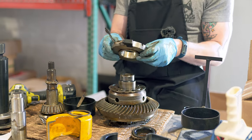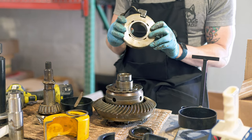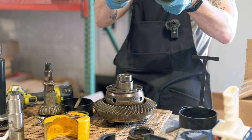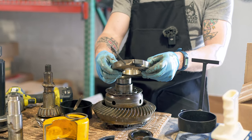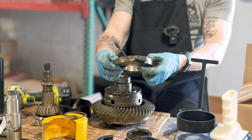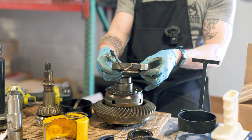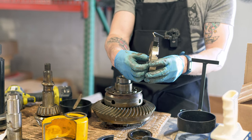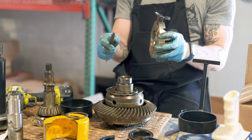If you're this far into your factory locked M226 or even a Dana 44 from a JK, one thing you ought to check is at the very top here. When you turn this upside down, this is the actuator for your electromagnet — when you give it 12 volts, this pops out. What can happen over time is that the outer flange up here can build a little lip, and that can cause this actuator to stick so your locker will not disengage. Take your fingernail and feel for a ridge. If you're catching a ridge, just take a file and knock that down so it's all smooth, then reassemble.